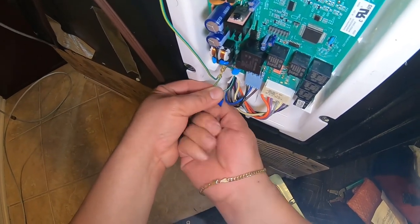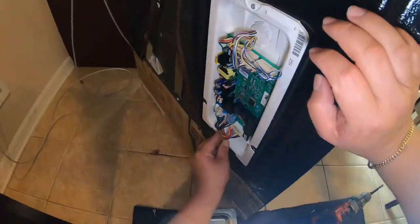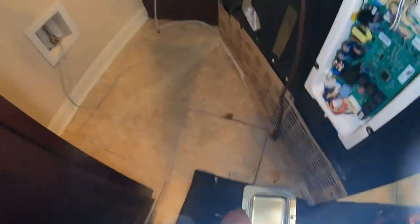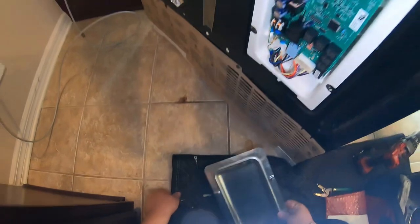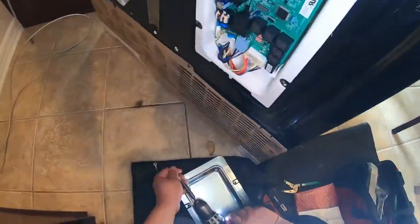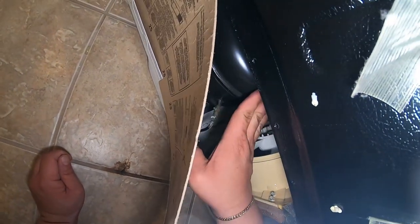Once you put that wire nut, locate the wire so it's out of the way of anything. This is a very simple repair — most likely you just have to replace the board. After you replace the board, go ahead and connect the refrigerator and make sure everything is working. At this point I can hear the compressor working and the fan inside, but I put my hand at the grill vent and I don't feel any air — the condenser fan motor is not spinning.